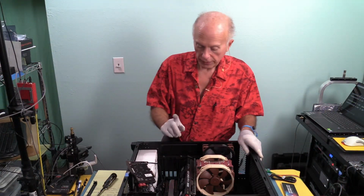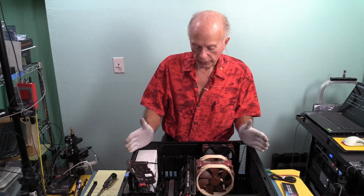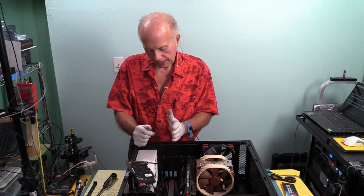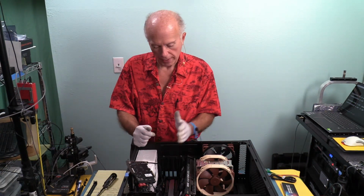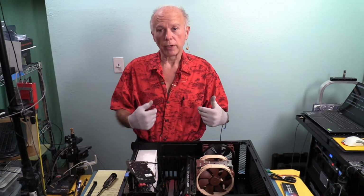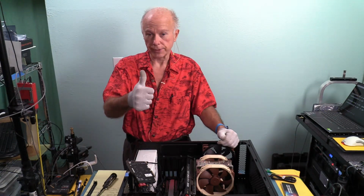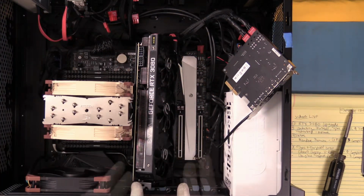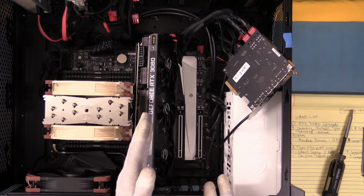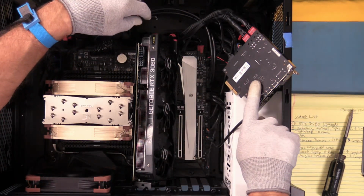For those of you that are eager to build your TRX40 platform, I think you're going to find this fascinating, because those slot alignments are a standard slot alignment. And this really brings up some interesting questions. So I'm glad we're going through this before some of you guys do. So prioritization, we have two 16-lane slots and two 8-lane slots. Because of the video card width being too thick, and this being a priority.